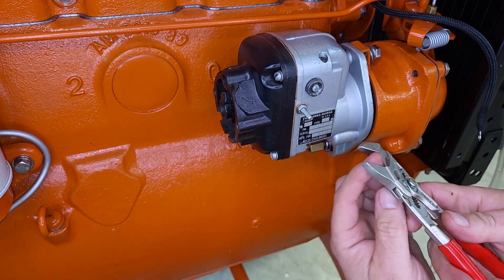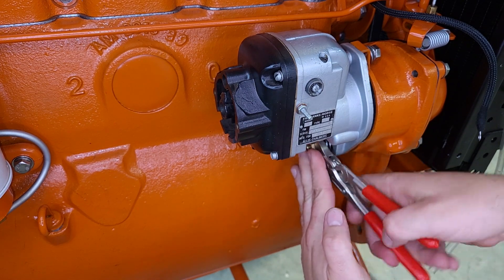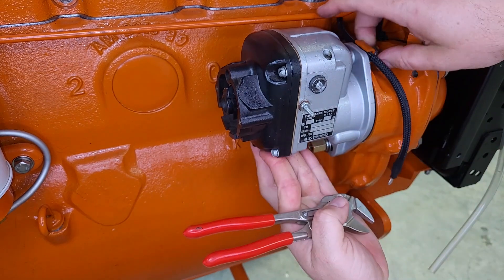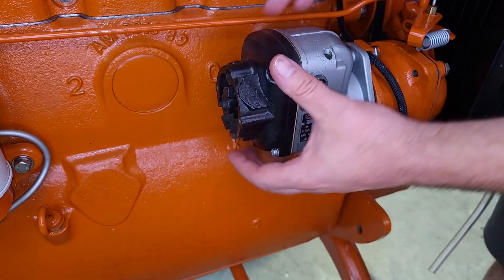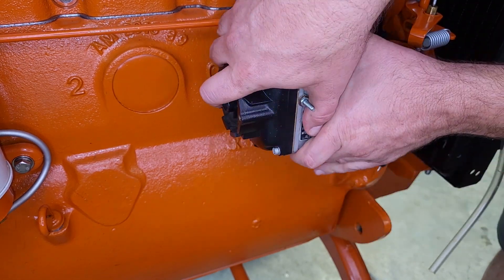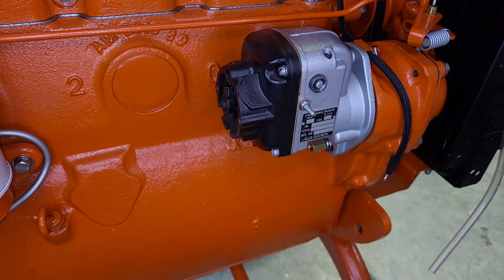One thing I noticed is I had a lot of oil in here, which is good — that means the governor is getting oil like it should. What happens is the oil accumulates, goes past this bushing, accumulates here, and drains back in through this hole. I just want to wipe off the sealing surface. We still line up top left and horizontal, so this should go pretty close to right in. These pliers are smooth-jawed so they won't mark up the housing. Normally I'd grab a wrench, but you don't want to tighten these super tight or you might crack the housing. Most of the time if you align this straight up and down it's going to be pretty close to in time — that gives you some room for minor adjustment.